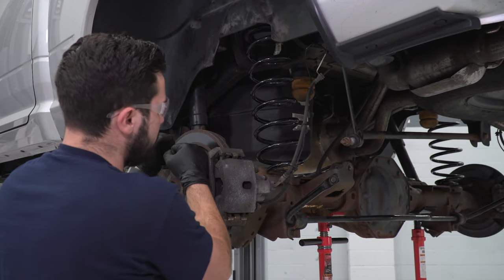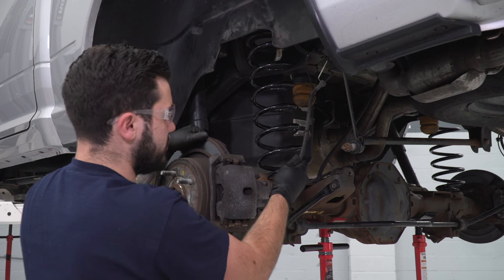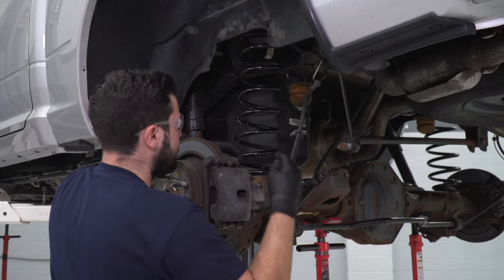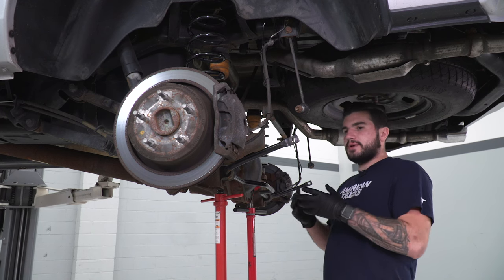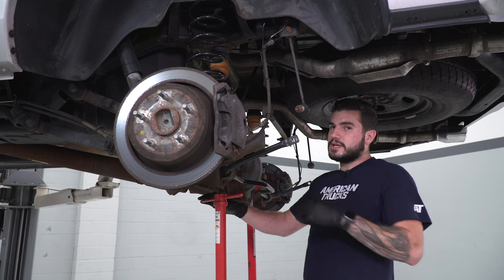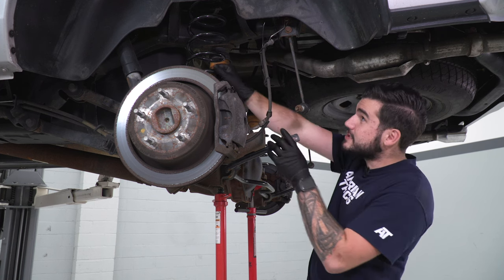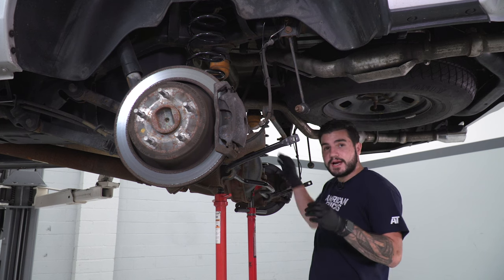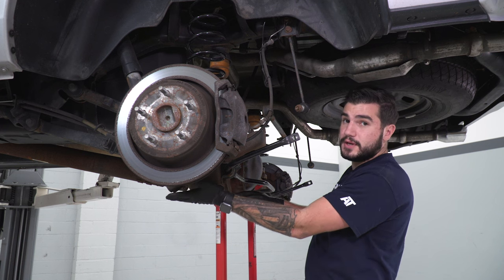You might need a helping hand to pull down on the rear axle assembly to get the spring in. If needed, unbolt the brake line from the frame to give yourself more slack. Do that on both sides. Once the spacer is in place, jack everything back up and re-bolt all components — the sway bar end link, the shock, and the panhard bar. Be very careful jacking back up since you're putting a lot of tension back on the spring. Make sure the spring is seated completely properly at the top and bottom. Jack up until the shock lines up with the axle mounting holes.